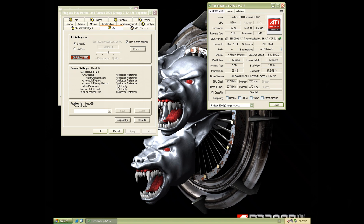Okay, here we are. Let's have a quick look at the video card in GPU-Z so we can see the Radeon specifications. The GPU clock is 277 MHz and the RAM runs at 270, but that's DDR memory so the effective clock speed is 540. Here we can see the driver — the Omega driver is based on Catalyst 7.12.